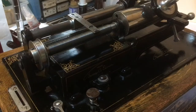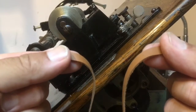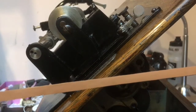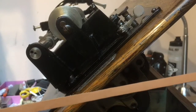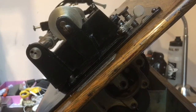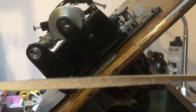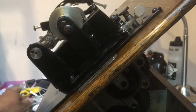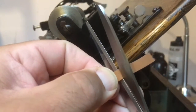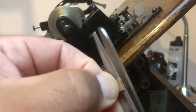I never throw out old drive belt — it's just the way I am. Now we're going to move to the next step. Now that we have our new drive belt ready, we're going to hold it by the ends and stretch it out. That's to stretch the fibers of the belt so it can't stretch anymore, because if you put a belt on a machine without stretching it, it will start to loosen quickly over a short period of time and then you'll have a slipping belt. So we're going to stretch it gently, holding it by the very ends. You don't have to use all of your strength. Then the ends of the belt where my fingers were, I'm just going to snip them off because those areas didn't stretch along with the rest of the belt.